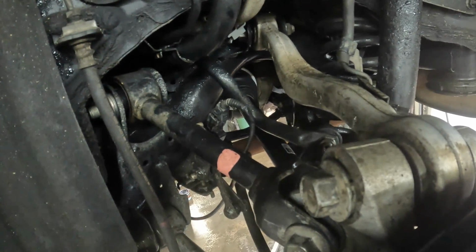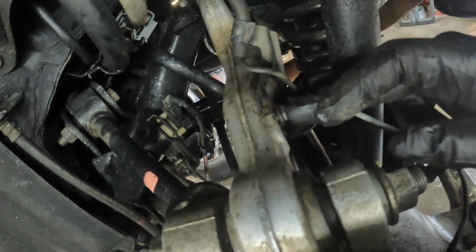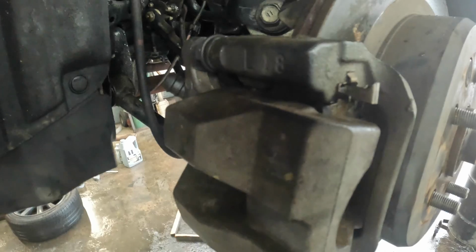And then all your little 10 millimeters are going to be like, I think, 96 inch-pounds or something like that. So I mean, it's just hand tight, so don't go crazy on torquing those down too tight, because you can strip it out of that aluminum. And then axle nut is going to be 214. Oh, and then your 14s on your brake caliper, they're just 36s.